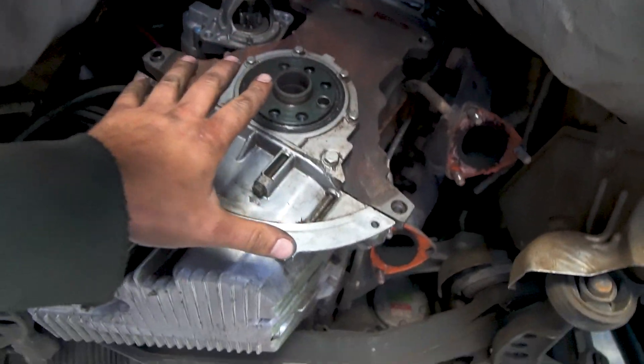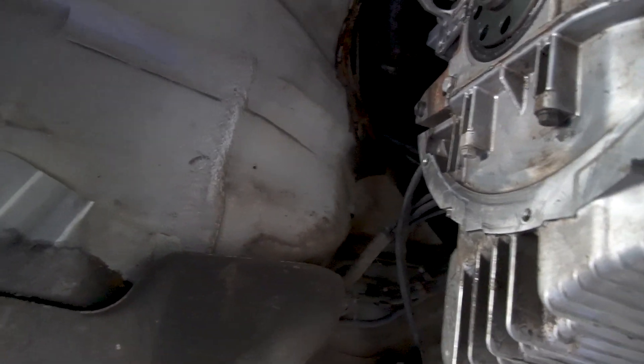When I do a manual swap, I like to do everything before I put the transmission on. I put the transmission and driveshaft on last. We're going to get all the shifter stuff mounted up, get the clutch assembly on, run all our hydraulic lines, and get our pedals installed inside. The trans is the very last thing we put on.